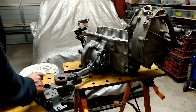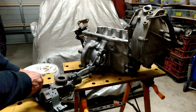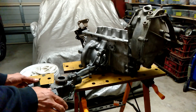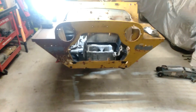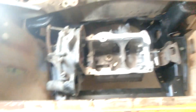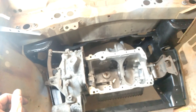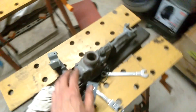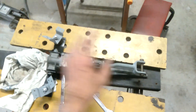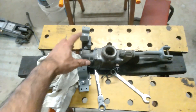It might be too heavy — actually I don't know, we'll wait and see. I'll get it and then work out what would be best. Because then we can sort of work out how these need to go. So I've refitted the subframe for the front and also installed the gearbox assembly — or the casing for it anyway. That's mounted using the mounting points on either side. What I need to do now is just go underneath and fit this mechanism — get it into its position, bolt it onto the gearbox, and then we can work out the distance where that needs to go, mark the position of those, and then just tack weld them in.